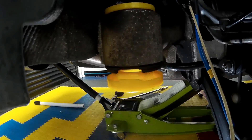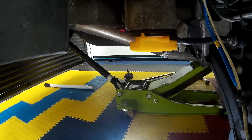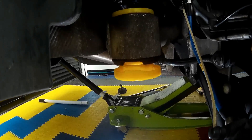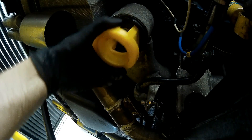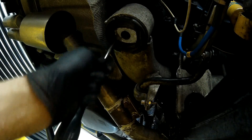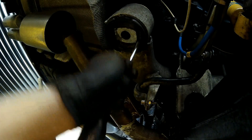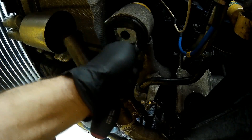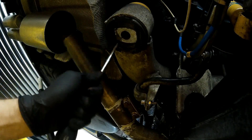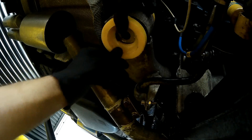The rear bush lower part is slightly larger and that goes up inside the bush. When you reattach the subframe to the car using the bolt, the big metal cup washer will pull this bush in and secure it in place. Do that for both rear sides then move on to the front. If you find the bush won't push fully home inside its rubber subframe counterpart, get a long screwdriver and push up slightly inside — you'll hear a little pop as it breaks the rubber casting. Inside there are just tiny little rubber bits left over from the casting manufacturing process, absolutely no reason for them to be there. Give your screwdriver a good shove up there, clear them out, and the bush insert will go all the way home without any issues.